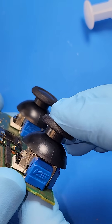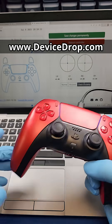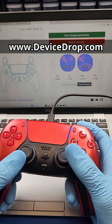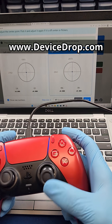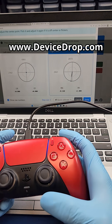Then I install the brand new caps and go through the calibration process of the joystick's end zones and the center dead zone, so that it gets absolute perfect centering. I even fine tune the centering so that it calibrates within 1% of the joystick when flicking it in any direction.